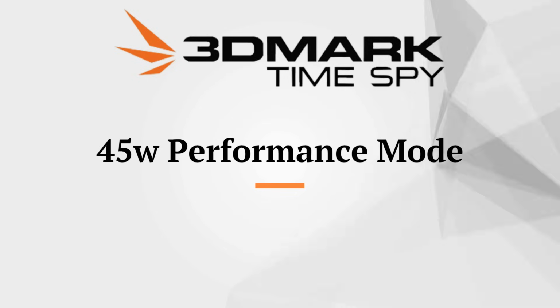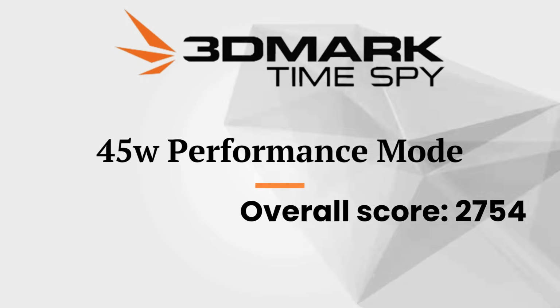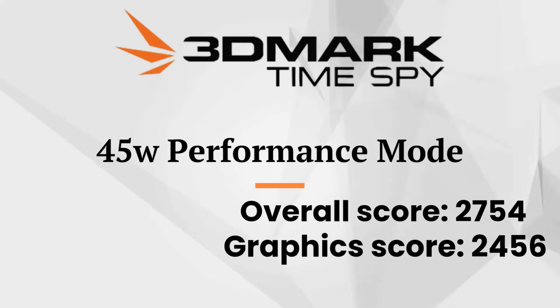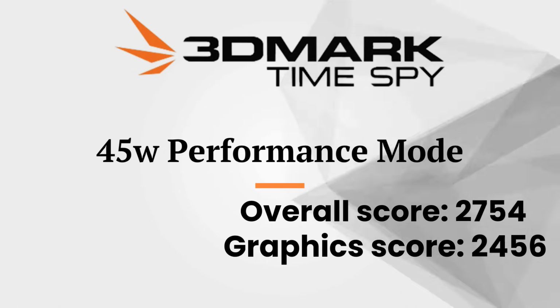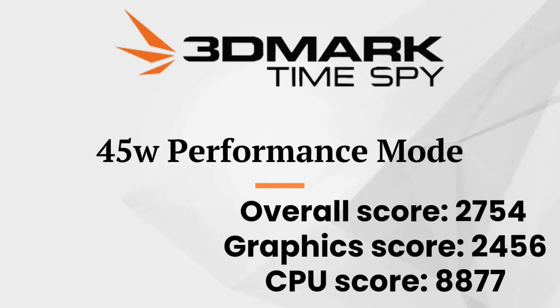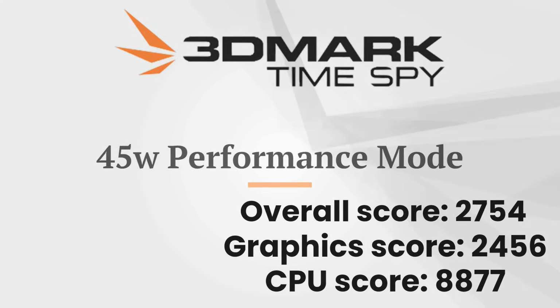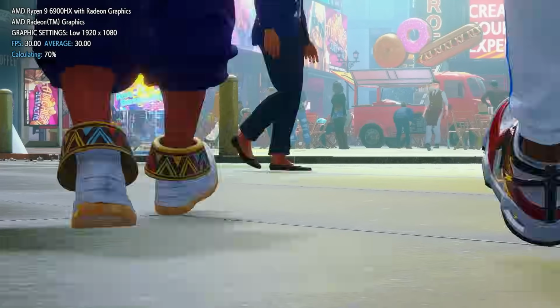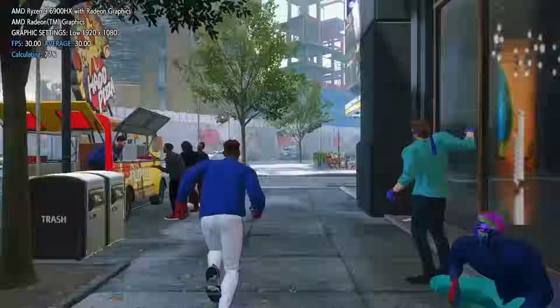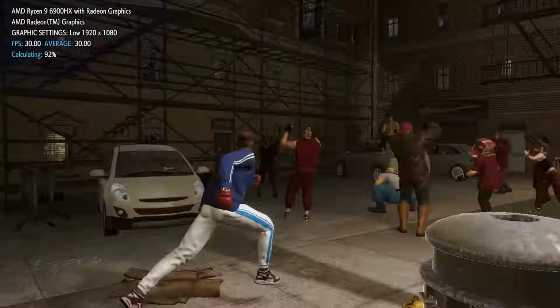Next we have the popular 3D Mark Time Spy benchmark, and again unsurprisingly it has better performance than the 6800U, with an overall score of 2,754, a graphics score of 2,456, and finally a CPU score of 8,877. The CPU performance in particular is pretty solid. Finally, I always like running at least one in-game benchmark tool, and here I have the Street Fighter 6 benchmark, and this is set to 1080p with low settings, and as you can see it does pass the Street Fighter 6 requirements at these settings.